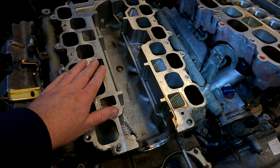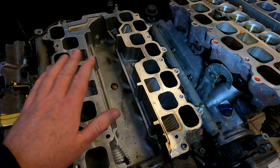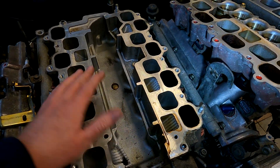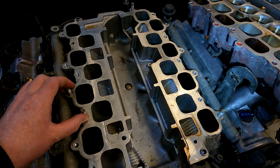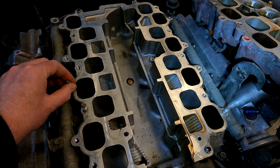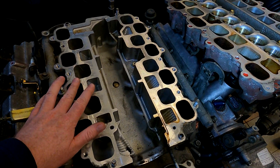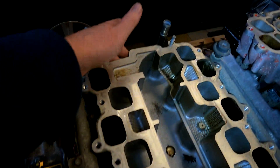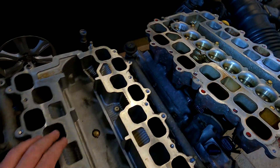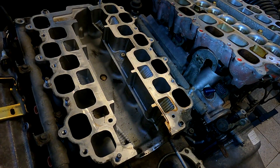Hopefully that's helpful to everybody. I'll try to get some extra material and put it in the description below if I can find it. If you've got one of these engines and you feel like it's lacking some low-down power, take a look at your little valve at the back there and see what it's doing after you start it up. Thanks for watching and we'll see you again soon.